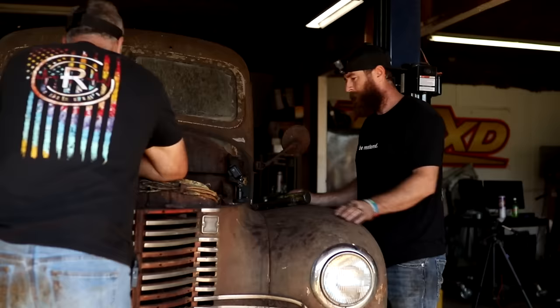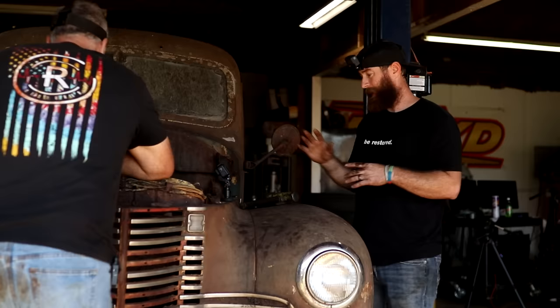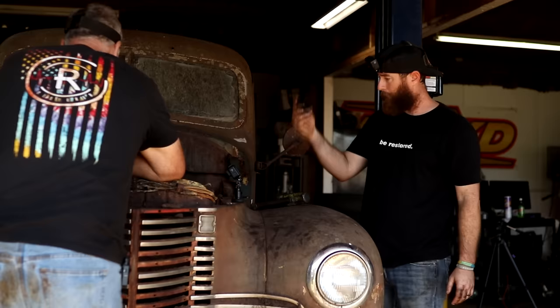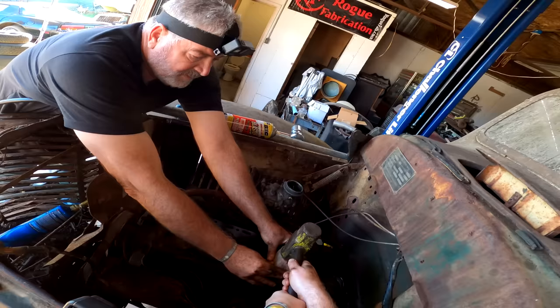Yeah. So we have been able to get this motor to at least turn over now, but we had to disconnect our number four cylinder there. So we're hitting it from the top and it's just locked up solid. Now this thing's been soaking for weeks now, but a lot of that penetrant just hasn't gotten down to the rust, obviously. So we're using this little rubber block, a rubber hammer, nothing seems to work. So we're gonna go see if we can maybe find a piece of oak, something that fits a little bit more to the size of the cylinder, give it a good whack with this old Thor sledgehammer, and maybe she'll move then.